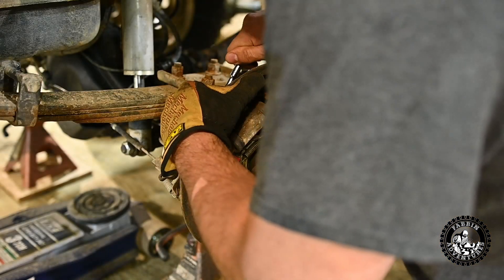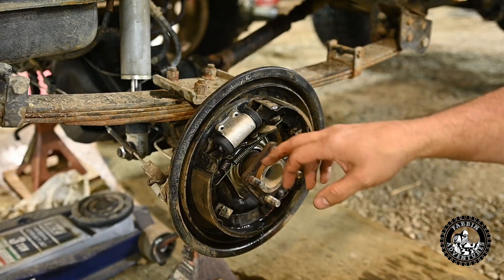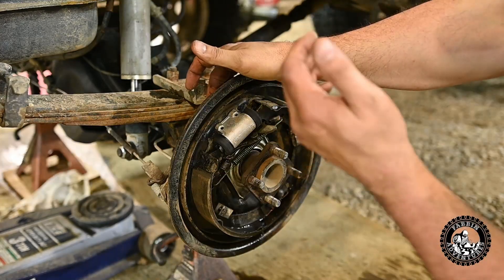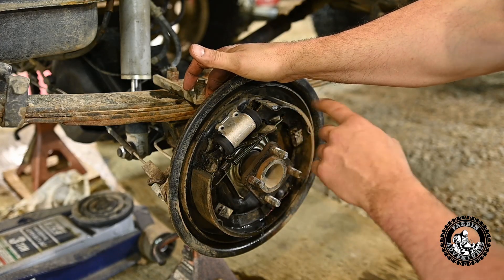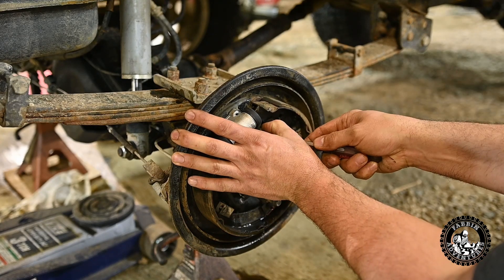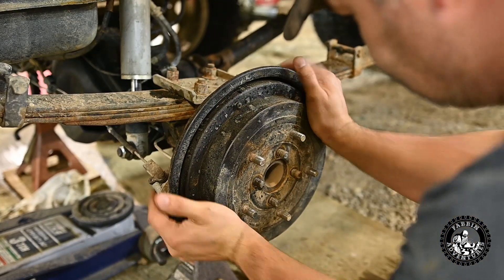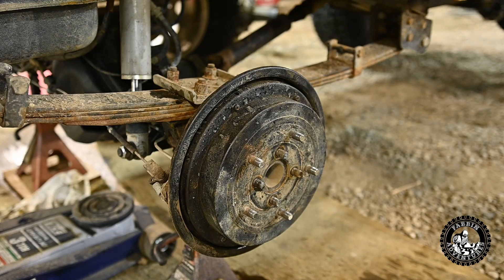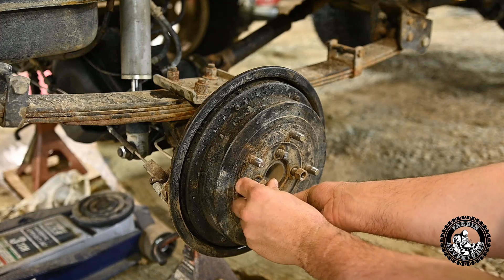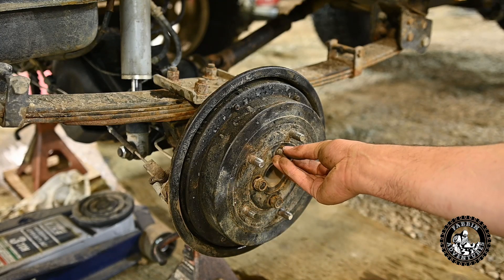So to take this off, there's two little 10-millimeter bolts back here and you need to take your brake line off. I removed this spring here just so I could pull my springs apart a little bit. Pull the old wheel cylinder out, put the new one in, make sure you keep your connections and your brake lines clean — if there's dirt and stuff back there, clean it off. You don't want to get dirt, junk, or rust in your brake system. Also make sure before you bleed your brakes you put your drums back on, because you're going to push your wheel cylinder apart — push the little pistons right out of there — and then you'll get dirt and junk in there.